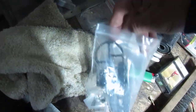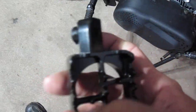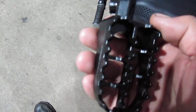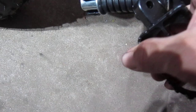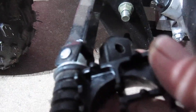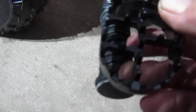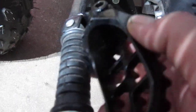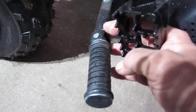I was looking at the foot pegs because I was thinking about putting these foot pegs on here — I had ordered them — but whoever put these foot pegs on, they go up like that. They don't match the whole alignment. If I wind it like that, the pegs are gonna have to be at a different angle. If I put it like this, the foot pegs are gonna be pointed down and facing the wrong way. So the foot pegs aren't gonna work here either — I have to cut this off and re-weld it to a different position.